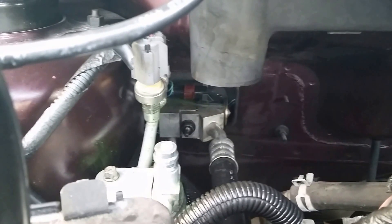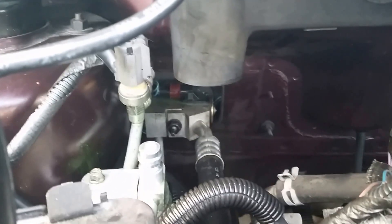We took the high pressure sensor off, wiggled it and cleaned the connections, put it back on, and bam — the fans came on and she's blowing 50 degree air out of the air conditioning. So that was it. I just wanted to put that up there because I saw nobody else had answered that question. Good luck guys.